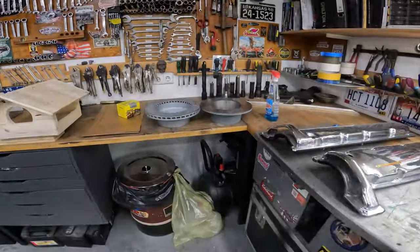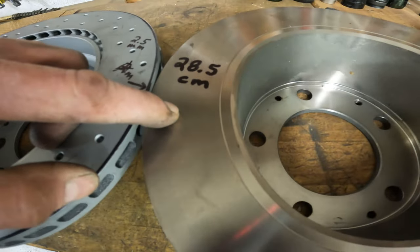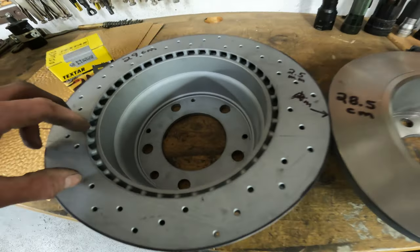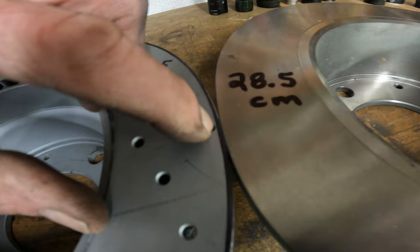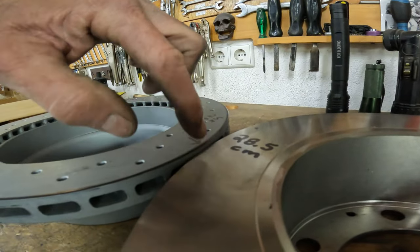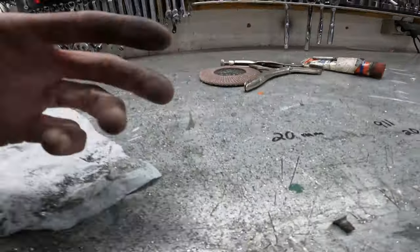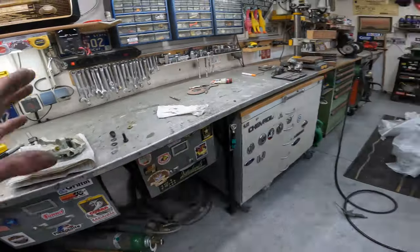The damage has been done — look at all the little shards. This is actually stainless steel, but it turned up pretty clean. This is not machining — this is me with that Harbor Freight oversized Dremel tool, but it looks pretty good. I didn't take anything away from the actual caliper itself, I just basically cleaned up Alex's work. But that still didn't solve the problem because the disc was hitting right here on this piece in the back. Discovery learning here in Roger's Hot Rod Garage. This vented disc is 29 centimeters, non-vented is 28.5 — that's 2.5 per side by my North Carolina math. I'm going to give it to my brother-in-law, they've got a big giant metal lathe at the shop and he'll turn this down for me tomorrow — just take a little 2.5 off here. And the metal shards, man — if you get one stuck in your hand, it hurts like the bejesus.